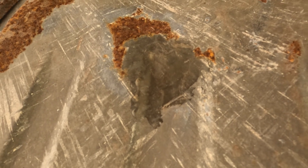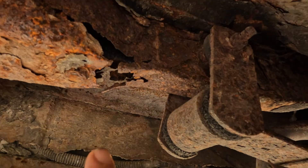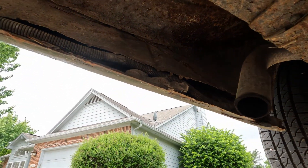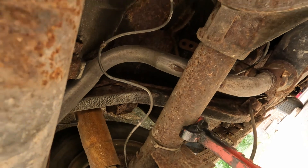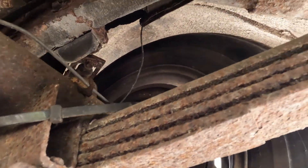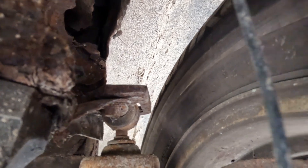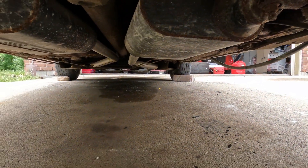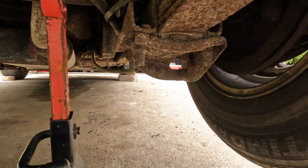There appears to be a big piece of JB Weld right here. The spring shackles seem to be solid. The bushings are not good, but they're not awful. It has air shocks on it that no longer work. On this side I'm not really worried, but when we come over to the other side — there's the top of the shock mount right there, that's not where it should be. Big hole, missing the shock mount. There's just rust. It's not as bad, but it does have two decent Flowmasters — that's about all I can say about that.